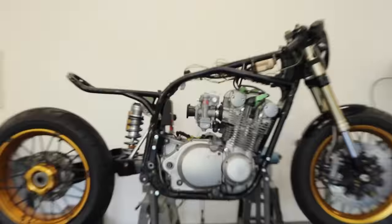Each of these power wires to the signal will go to the one LED up here. In order to make sure that I'm not getting power going through the LED and then back to the other signal, I used one of these diodes on each wire. This is basically like a one-way valve for the electricity. Sends it up one way, but doesn't allow it to come back the other way. So that's in there. That's all wired up. Everything is good to go.